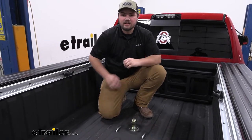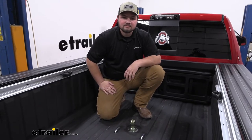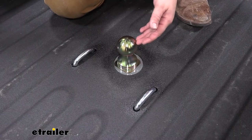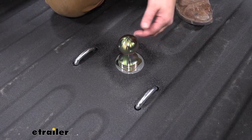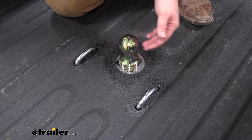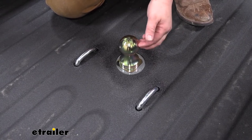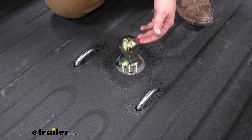Not only that, you do get a higher weight capacity. This hitch offers us a 30,000 pound weight capacity. We're also going to have a vertical load limit of 7,500 pounds. Now pairing that with the 30,000 pound total trailer capacity, you want to keep in mind that's the weight of the trailer and the load included. But it always is a good idea to check with your Ram's owner's manual to make sure that your truck is capable of those numbers. Always go with the lowest number between the two.